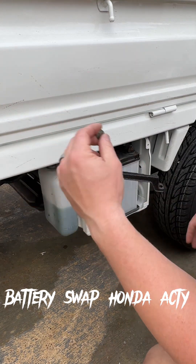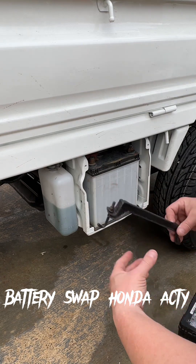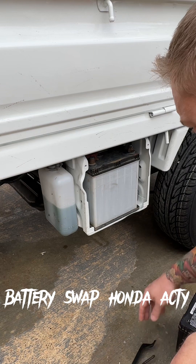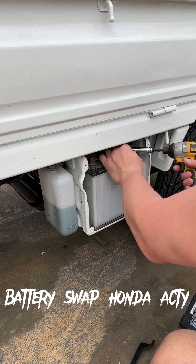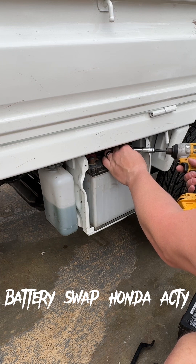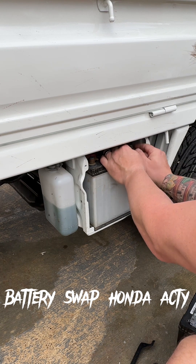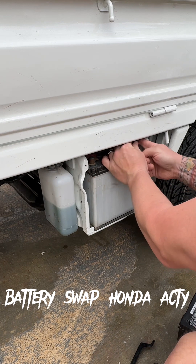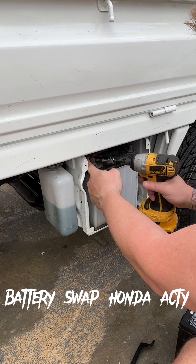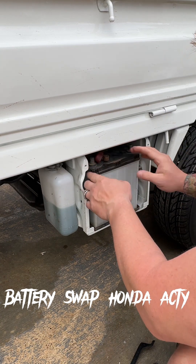These are 10 millimeters, just so you know. This little guy just comes off — it's got a hook that goes on this side, you take that off. These are also 10 millimeter. You shouldn't have to take them all the way off, but mine are a little rusty — it should come right off. Your positive is on the other side, same deal. Now's a good time to probably clean those.